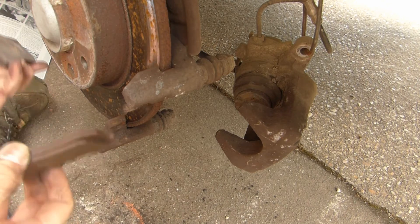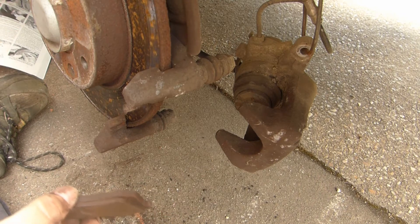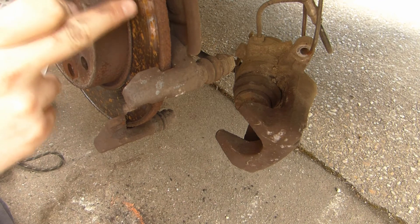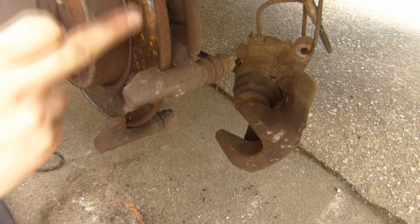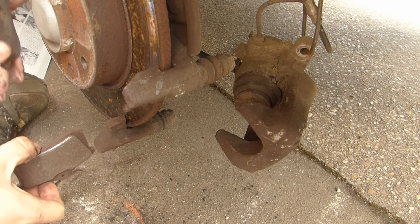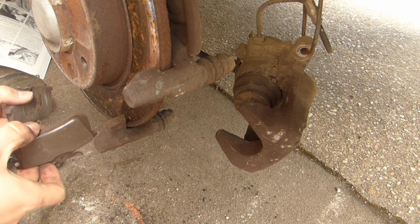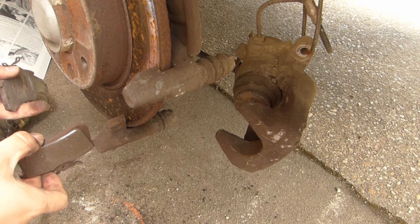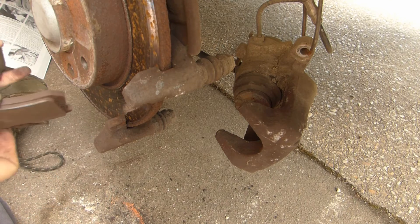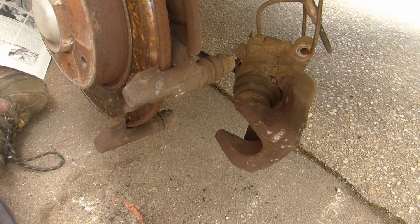But the brake disc is looking quite rough. You can see places where the handbrake pads have pretty much burnt into, or rusted in, seeing that the vehicle has not been driven a lot. There's a lot of scoring lines, it's quite rough. Here and there are some blue spots and some very small cracking. Can't see clearly because of the rust spots as it rained last night.